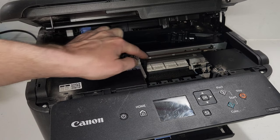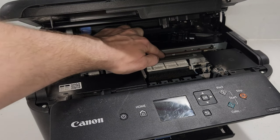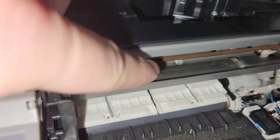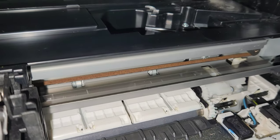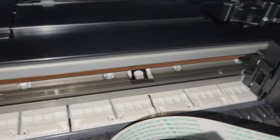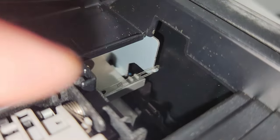Sometimes you'll see visible ink buildup on the strip — it's going to look darker. It doesn't need to be cleaned very thoroughly, just enough to remove anything blocking it, which is usually just a small dot of ink. Here's a closer look — this is the strip right in the middle of the screen. The drive belt is in the back and we're not touching that. This is the timing strip, only about a quarter inch wide. Be careful when cleaning it because if you push too far it may come off this hook and you'll need to reattach it.